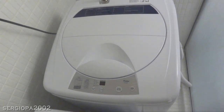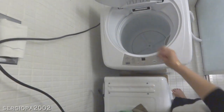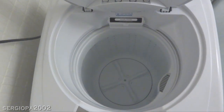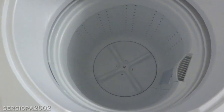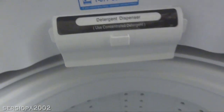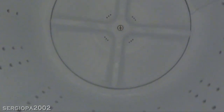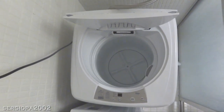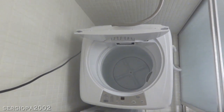Just so you know, the spin already does a really good job of spinning the water out, so you probably won't need to use the spin-only cycle very often. As for the capacity, it's about 13 inches tall to the lower edge of the rim and 13 inches in diameter — it holds about half of your standard load of laundry. For bigger items like thick sweaters, big towels, washable jackets, or large jeans, I suggest only filling it up about half to two-thirds of the way, because large pieces hold more water and don't get a good spin. With big items, the machine will actually stop and restart the last cycle to get a balanced spin — it adds water back to the set level to even out the weight of the articles.